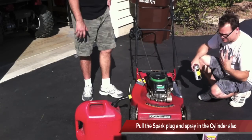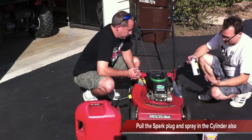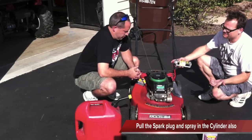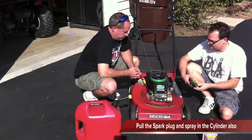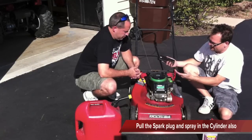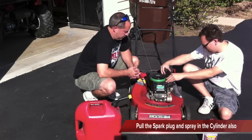That is it. As you can see, some smoke was coming out — that means the oil is in there burning. You don't really have to flood it. A lot of people just spray until the engine stops. I like it to burn up in there a little bit, coat the rings, coat all that. So that is it — we put it all back together. She is winterized and ready for spring.